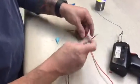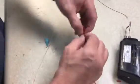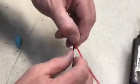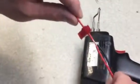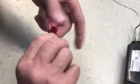Now if this were a thicker wire, what you're gonna do is insert it through there and then twist it around. If it's a small wire like this though, what we're gonna do is just twist this guy around - nice and tight. Look at the spiral on that, it's nice and tight, it's not going anywhere. Then take your tape - don't get a big long strip, just like that. Electrical tape is all you need. Lay the head of it right there, twist and pull. Look how professional that looks, and it's solid, it's not going anywhere.